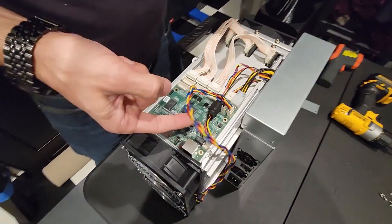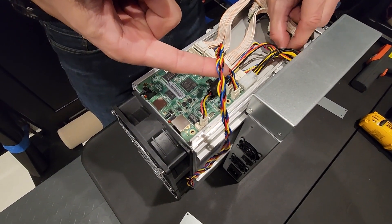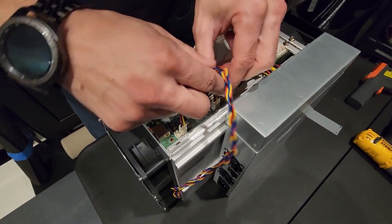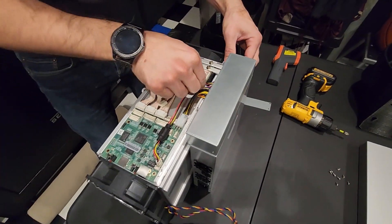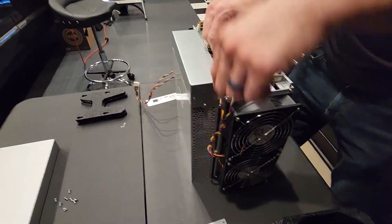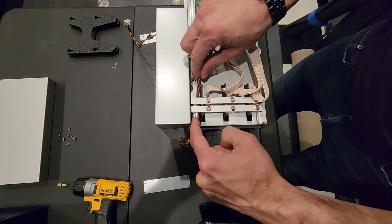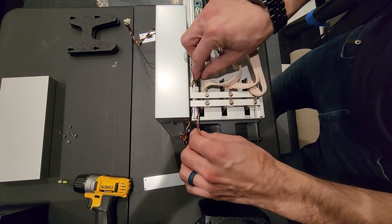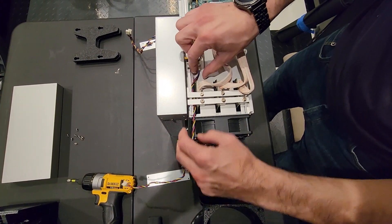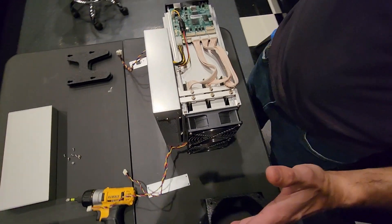So we've got our fan wires here going to the control board. We're going to go ahead and take these two off, and then the other fans for the back are hiding here and here, so we'll take those off too and add our spoofers. The best way to get these out is to kind of fish them — floss it this way until it's right between the frame and the screws, and that area allows enough room for that terminal end to come through. That way I don't have to loosen the boards or anything like that.